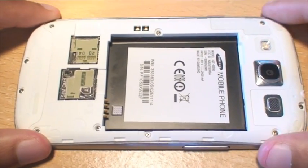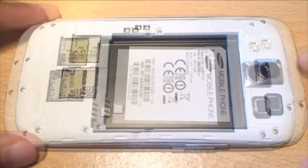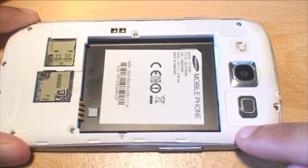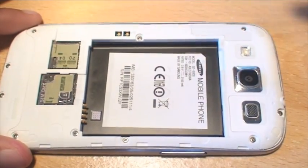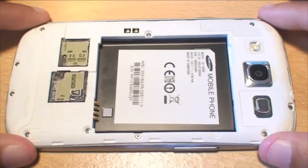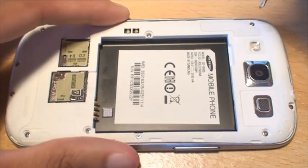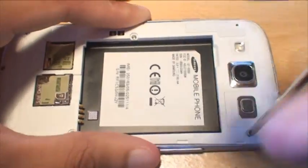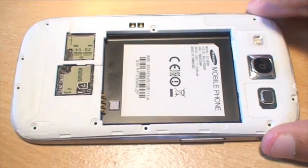What we need to do is get a Phillips head screwdriver because we're going to be removing the screws along the phone. You've got 10 Phillips screws along the back that we need to remove. So get a Phillips screwdriver as I have here and we'll get those removed. That's the 10 screws now out.